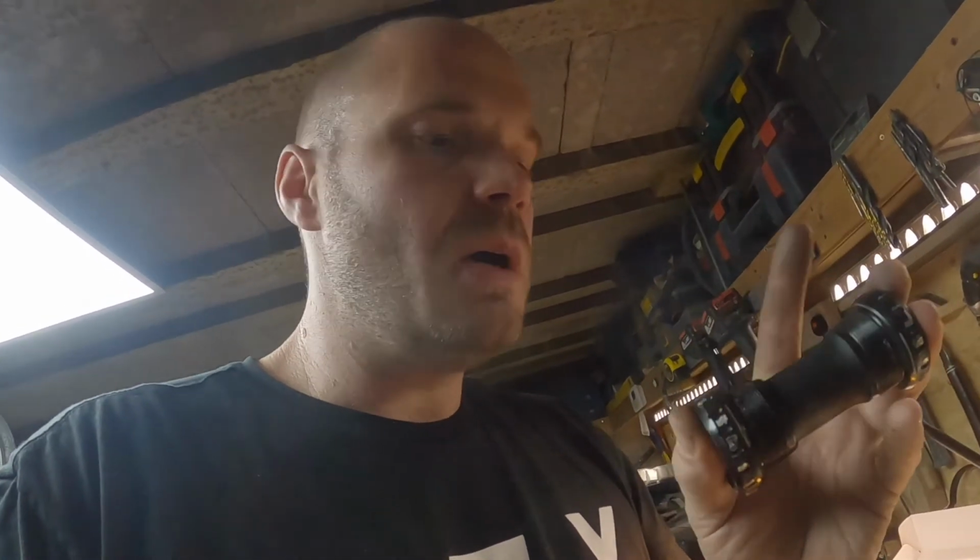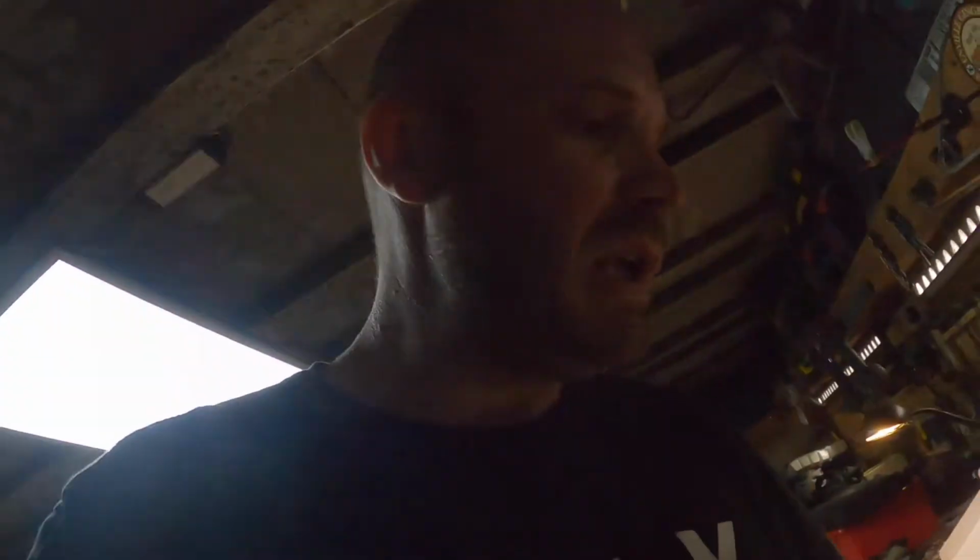I think the 63 millimeter bottom bracket and the 68 and the 73 are actually the same product. It's just that you have to double up on the spaces on one. I think you always need one set of spacings on the drive side. So I'll show you quickly with my old vernier the measurement that you need to take on the actual bike. Sorry, the Nukeproof is just propped up on here.